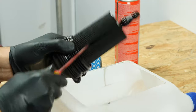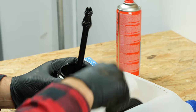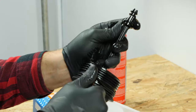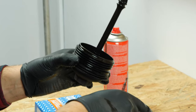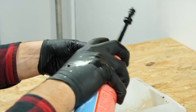With a large flathead screwdriver, lever off the paper cartridge to separate it from the flange. Then, with a thin flathead screwdriver, remove the rubber O-ring seal located under the flange washer, and the two seals located on the end of the flange shaft. Start by cleaning the filter flange with brake cleaner fluid and a piece of tissue.